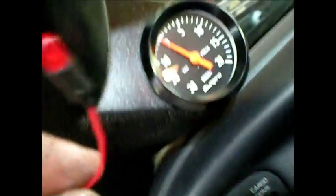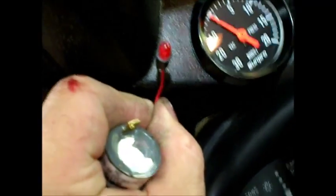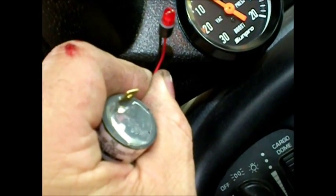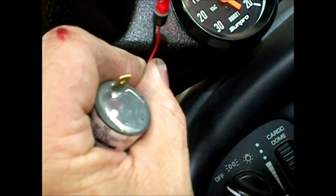I'm going to show you what I'm going to do with it. I'm about to finish up my install of my SunPro boost gauge and transmission temperature gauge. I'm going to drill a little hole and stick that right there. That little red light will come on at 5 pounds and tell me to stop before I take out my pump.